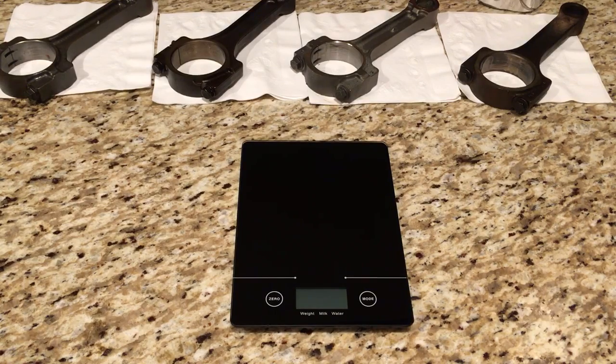I talked to a person with a lot of machine shop experience. He had a catalog covering the 1990s for TRW forged pistons. He pointed out that it's a common practice to bore old 350 small block Chevys 30, 40, or 60 thousandths, and for a long time it was not common practice to rebalance those assemblies. His point, which he validated through the catalog, is that between a standard bore piston and a 60-over piston, that could easily be a 35-gram increase.